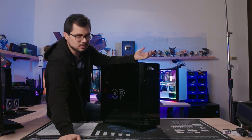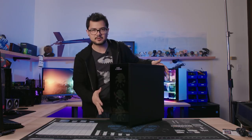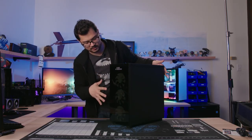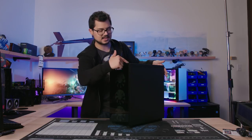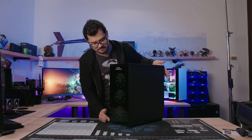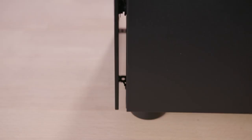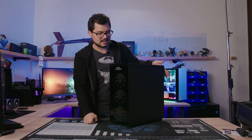The side branding is large but tasteful — not a terrible looking logo. Looking closely at the front panel, it's fully tempered glass with three included 120mm fans. There's a very thin ventilation gap along the bottom, right side, and top, but the left side is completely closed off where the tempered glass panel meets the front. I'm a little concerned that this gap is way too narrow to allow healthy airflow in — those front fans are going to be choked for sure.